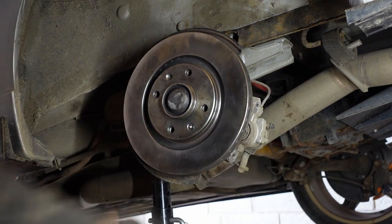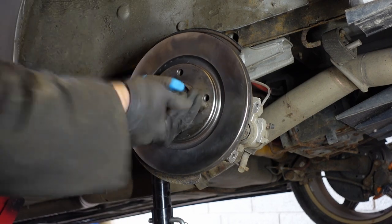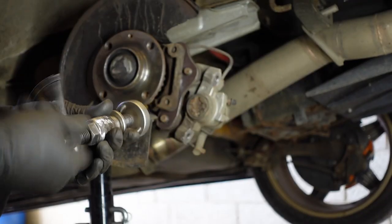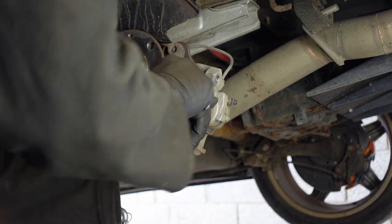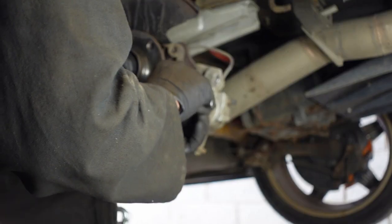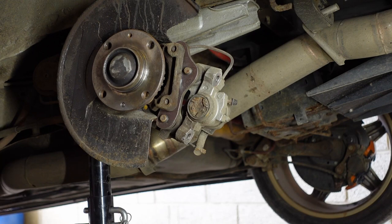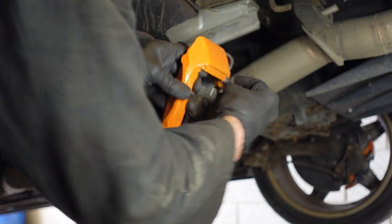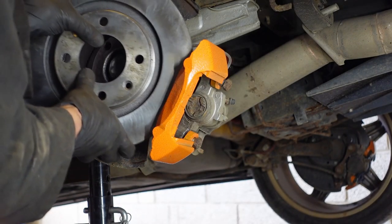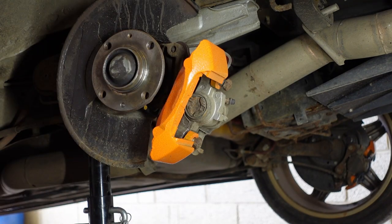You need to wind your caliper back in — stupid boy! So you will just need to wind the caliper in using a caliper wind tool. Just push hard and rotate clockwise, and it'll work its way in. It doesn't hurt to put a little bit of grease just behind the boot. I'd like to see whether it's possible to fit the disc — if you ever need to change discs and pads, can we do it with the caliper carrier in place? Yes, we can! That's a win, so let's do that and show how it's done.